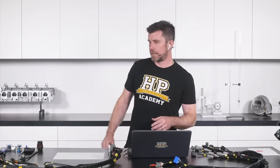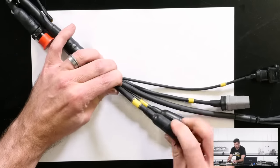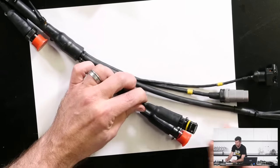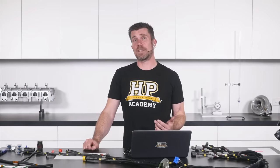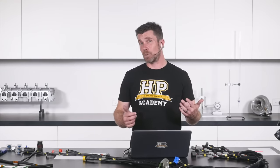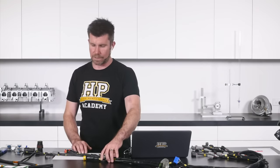Looking at a couple of these connectors under the overhead camera, we can see little labels — one is 'ignition interconnection', one is 'fuel interconnection' — with different coloured bands. The labels mean a mechanic can at a glance see exactly where each connector goes. The different colour bands relate to the keyway on that particular Autosport connector, making it physically impossible to connect the fuel sub-harness to the ignition sub-harness. This takes human error out of the equation entirely.